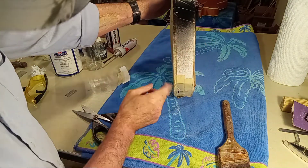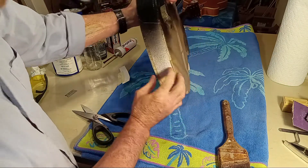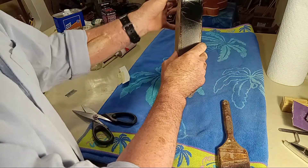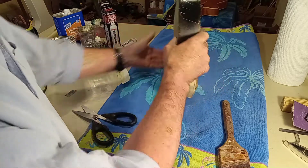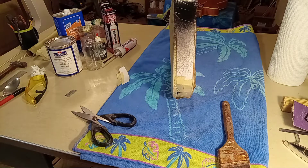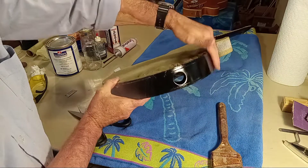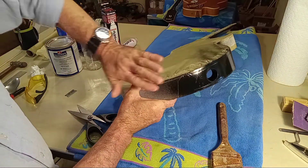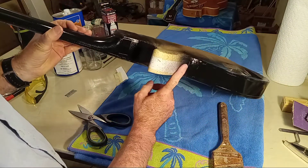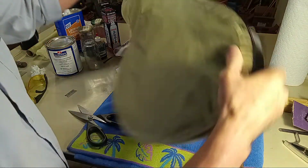I came in with the 60-pound paper, pulled it real tight, and taped it down. I wasn't worried about overspray getting under there because I was only painting that specific area. You can see how I taped off the area I did not want to catch any paint — because I'm going to buff and sand and blend this into the old body.